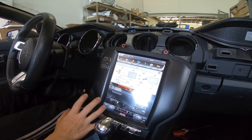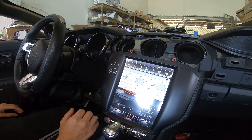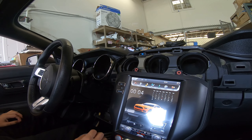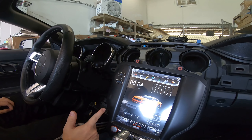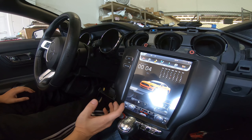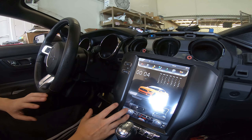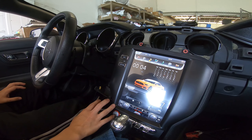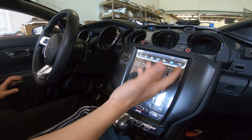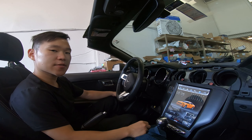So that's how to install your Mustang. This is the Android 7.1 unit. We did just come out with the PX6 unit, and that will be compatible with the Mustang Shelby cars — so if you have a Mustang Shelby, check out the PX6 unit, as that unit is more compatible. This Android 7.1 unit works with both base and premium Mustangs. If you have the premium model with a Bose sound system or Bang & Olufsen, we still suggest the PX6 unit — the sound will work better there. Most cases you shouldn't have to do amp bypassing with these plug-and-play units. If you have any other questions, send us an email or give us a call. Thank you guys for watching, and I'll see you in the next video. Bye, guys.